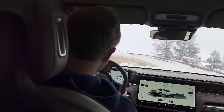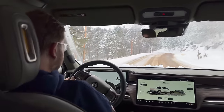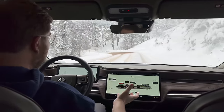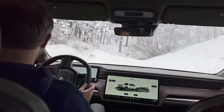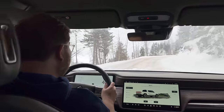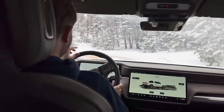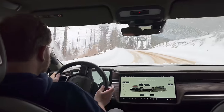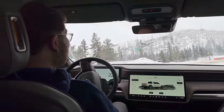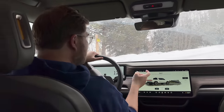Full sideways — yes, it still does some spin control, which is kind of funny. Into the corner — look at this — just super nice. Applying power gives us a really nice neutral oversteering character. You basically want to go slow in, get the truck set, then do a big skid on the way out on wide-open throttle. Even with stability off it's not allowing much wheel spin — probably to protect the half shafts from a low-mu to high-mu transition, so they don't snap half shafts or motor mounts. But it's just this character where you can stick it into a corner and get the truck sideways — you're not going to find that in anything else. It's dead silent too, so no one hears you driving like this. Full rally mode up the hill — it's unlike anything else. That is so cool. Land rover cannot electrify the Defender quickly enough.